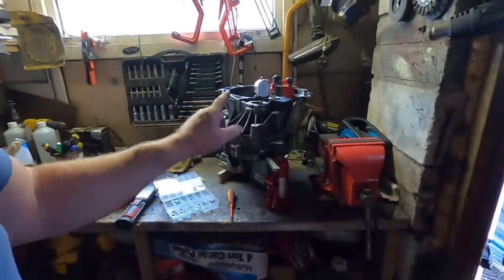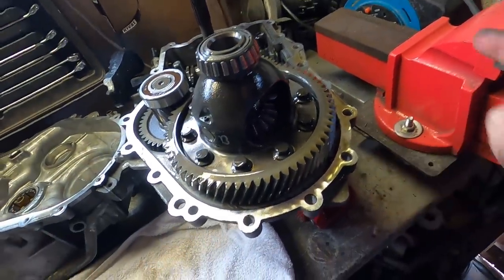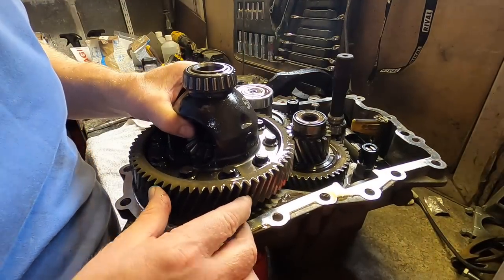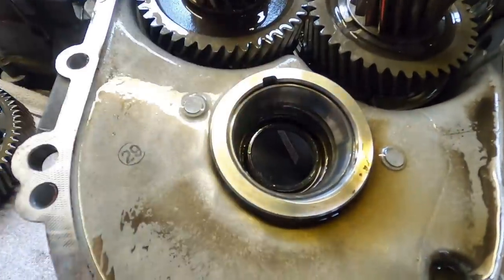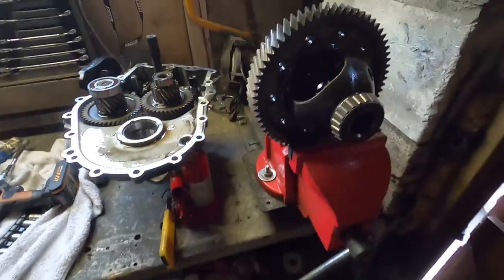That's interesting - it tells us we've got a bit more tolerance than the exact 0.144mm. I'll pull it all apart now and start getting ready to measure preload on the CAS diff. I'm going to take the original diff out now - we've got to remove the main ring gear and swap it onto the CAS. We can get the driveshaft clips out just like that. We'll also knock the seals out while we've got it open - we've got new ones to go in, so this makes it much easier.